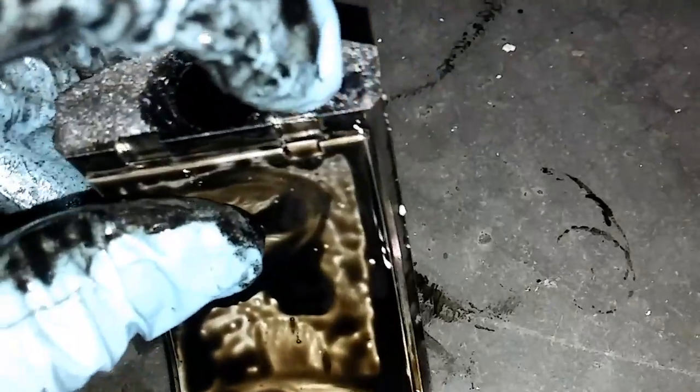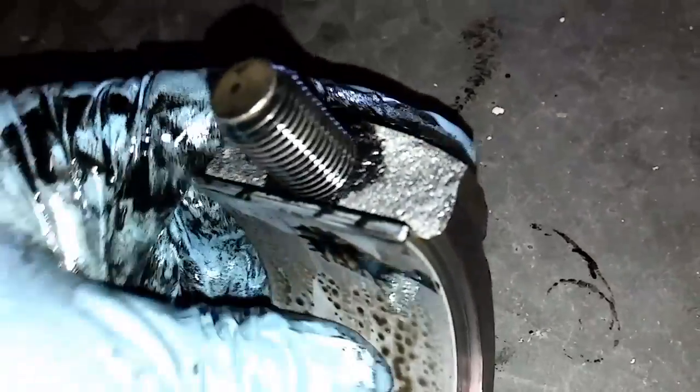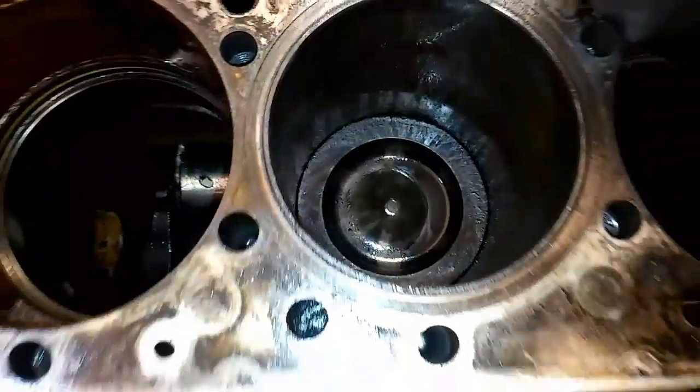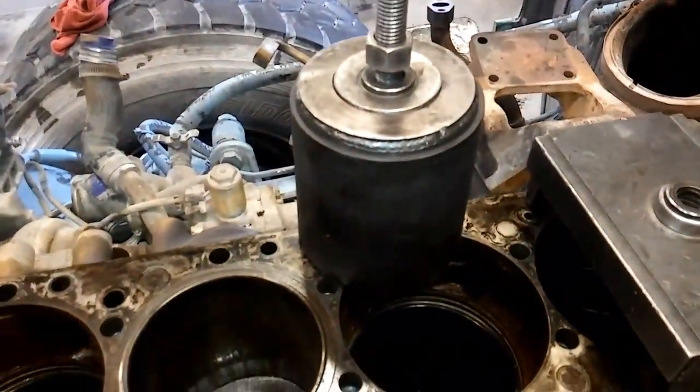There's your connecting rod and the bearing stayed in place, and your cap. Now these are what they call fractured rods. Take a look at the bearing — no visible damage, that's good. If you look at the rod where it connects, it looks broken and jagged, and that's normal. This is a fractured rod — when they machine it they actually break it at a weak point, and when it goes back together it will fit perfectly; you won't even see a seam. These are very fragile — do not put them face down. We're looking at your cylinders; I'm going to be removing cylinder pack two to show you how to do that.